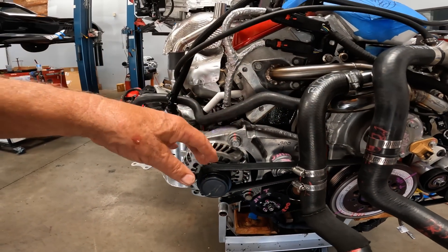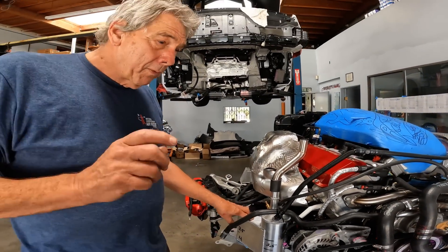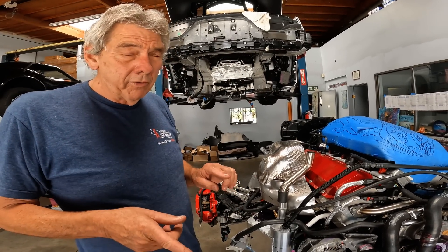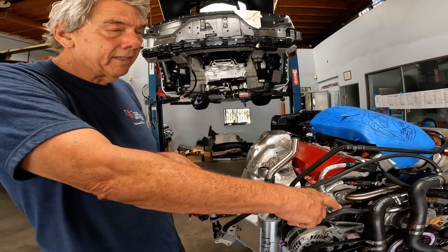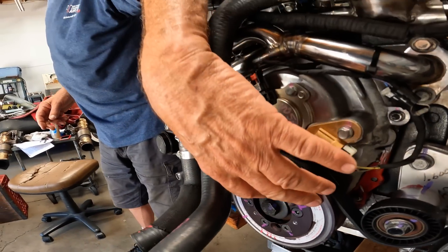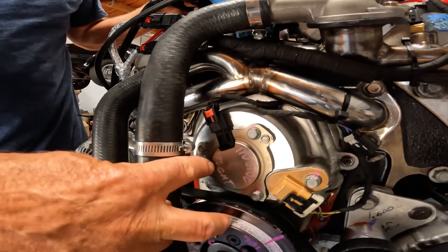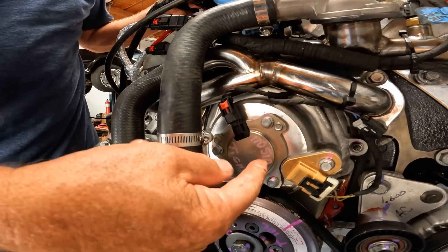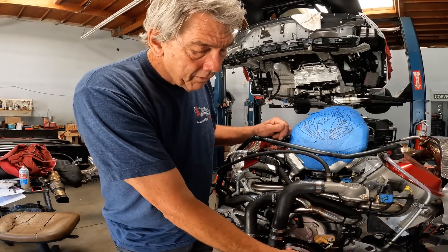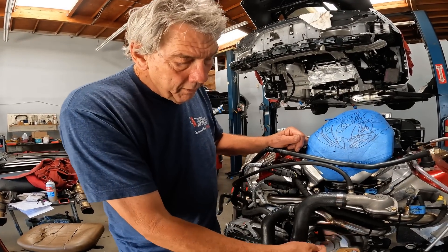This is your custom sump that you had to make. We're going to go ahead and run the motor. I need to run it and check to make sure that 16-degree difference between crankshaft phasing and camshaft phasing was in camshaft degrees and not crankshaft degrees. Because when we started indicating the cam and crank again, the 16 degrees we changed here made 32 degrees down there — so our numbers were all off. This started giving us concern because I'm assuming the computer is measuring the difference between these two parts here, but if it's reading it down at the crank, then this should have been moved eight degrees, not 16. We don't know yet. If it's reading off the crank, it should have been eight here, and if it's reading from here then the 16 is correct.